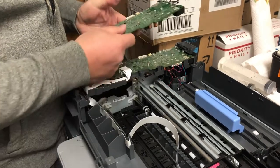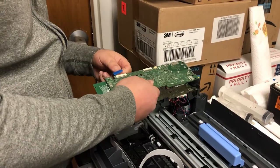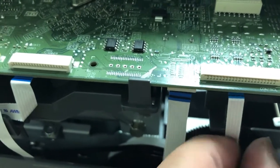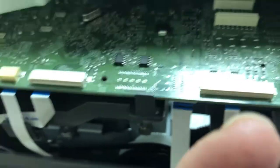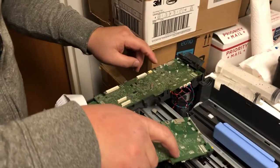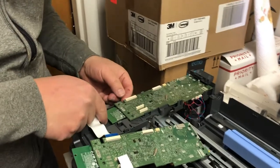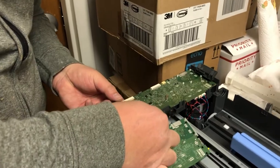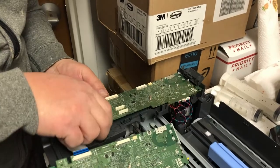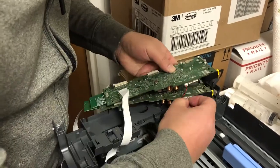I disconnect the power — those two connectors, and the big cable. Make sure you get both of those little cables: one is narrower, one is bigger. Remember, the blue side is up towards the sky — same thing here with the blue side. There's a screw here so you have to unscrew it first. Once you unscrew it, there are tabs here, here, here, and here to release the board.